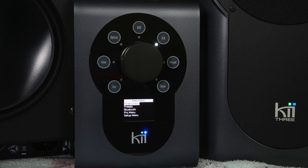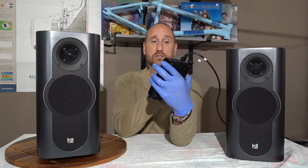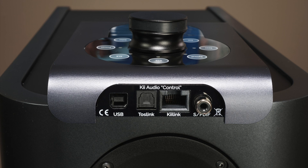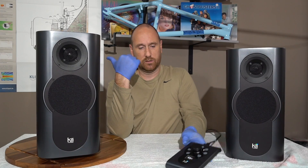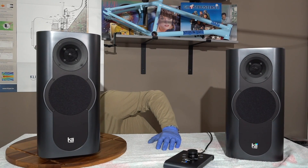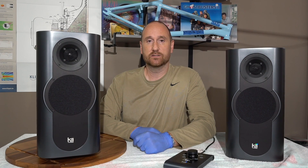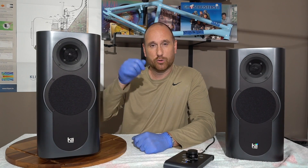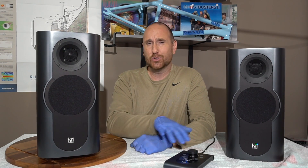While talking about the controller — you've got a few different input options on here, and this big dial to control the volume. It hooks up via an Ethernet-type cable that runs to the back of the speaker and also has additional inputs and outputs: SPDIF, TOS link, and USB. The speaker itself has digital and analog inputs — you just flip a switch to set it. It also has boundary settings you can adjust and a trim knob for tonality. You don't necessarily have to have the controller to make those adjustments — the controller just makes it super easy.